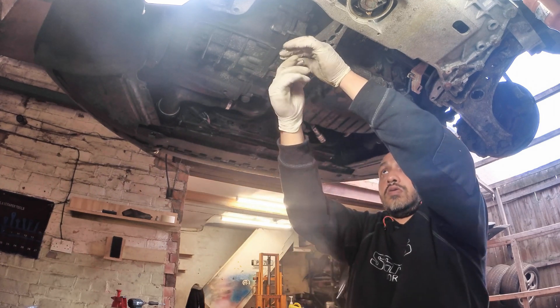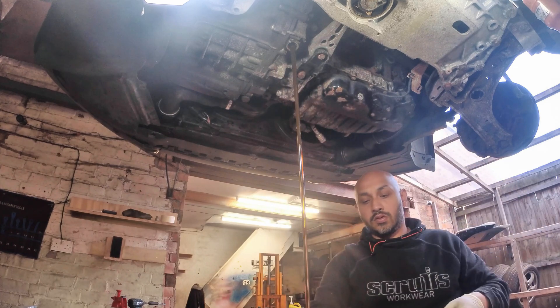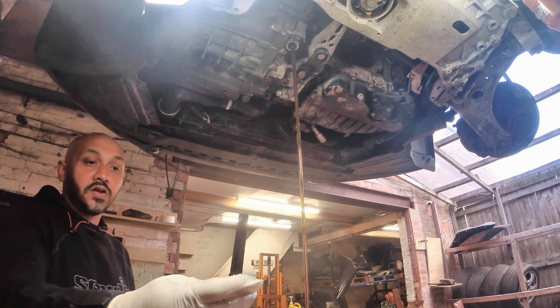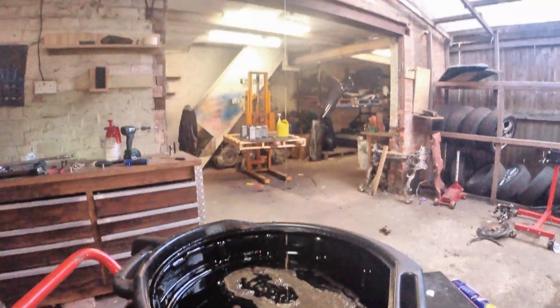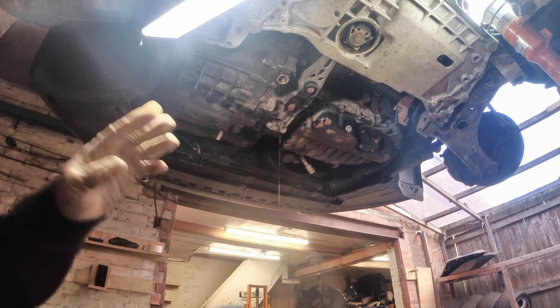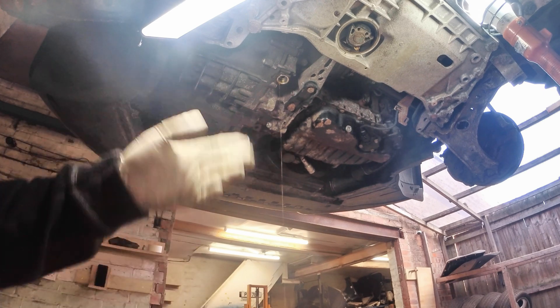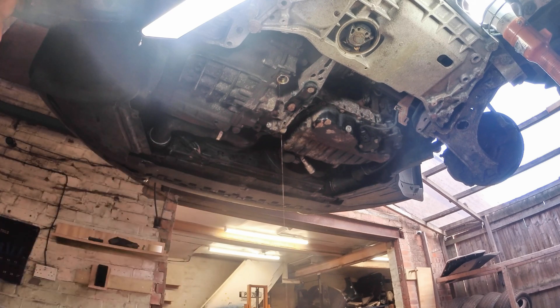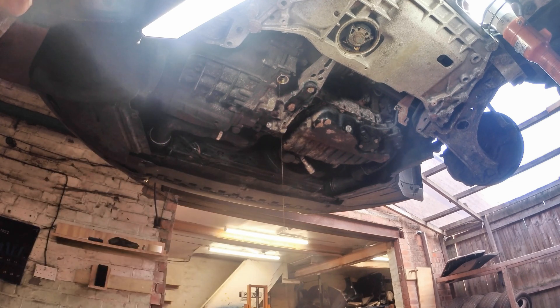This is your level - when it gets to about there it'll come back out; let everything drain till it stops. Some people measure what goes in and comes back out but that's not always the case. When you put five liters back in it takes about four and a half liters. When you warm it up to temperature it circulates and cleans everything with the new oil's additives. What you must do is after filling, run it up to 37 degrees and pull it back out - you overfill by about 200ml and let that back out, otherwise there's no point doing this.